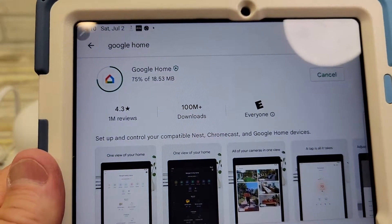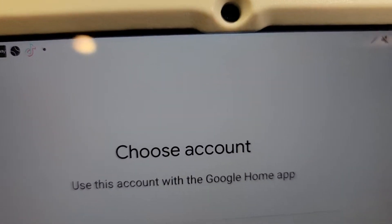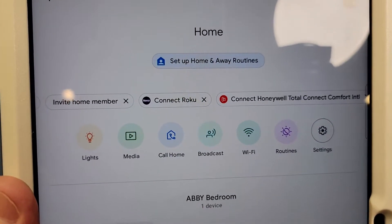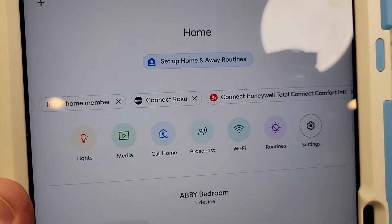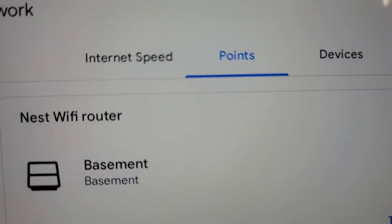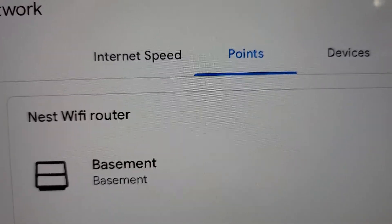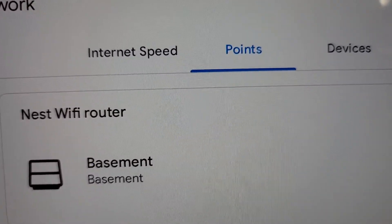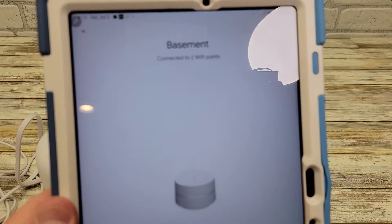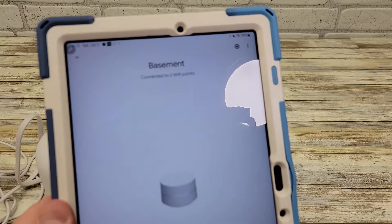Install that and then open it up. You will have to open up an account — you will have to use your Gmail account to choose an account. You'll have to give it access to use your location and other things. Then click on Wi-Fi, and there should be a thing that says add new Wi-Fi router. Click and it should show up as your Nest Wi-Fi router. With this you can go in and give it your own SSID — that's the name that transmits for the Wi-Fi — and you can give it a password and create a guest account.